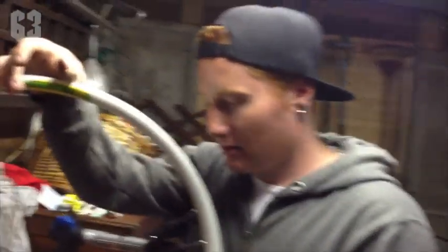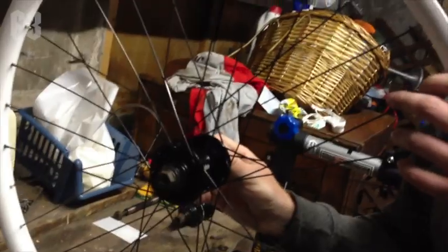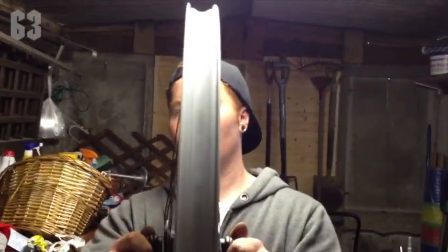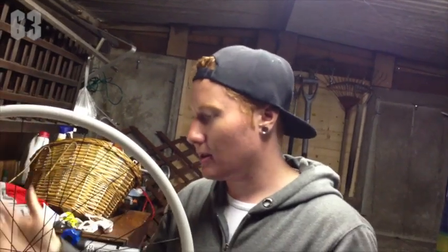After you've done that, your spokes will probably still be a bit loose, which is fine. You can then put the wheel in a truing stand or some upside-down forks and true your wheel so that it runs nice and not buckled. That is how to build a wheel. Be sure to check out my next video, which will probably be how to true a wheel. Thank you for watching — remember to subscribe, message me if you have any questions, and find me on Facebook and Twitter.